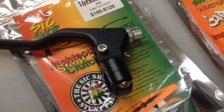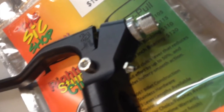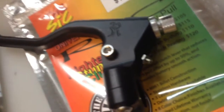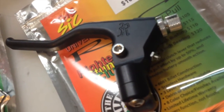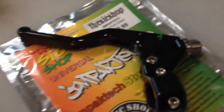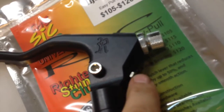Some people with shorter fingers may not want to pull as far. On the RSC there's also a set screw adjuster that you can dial in to push the lever out, setting where it rests when fully closed, to get the lever closer to the bar. I've really never seen anyone use that — the purpose would be for shorter travel — but most bikes won't work with it because you need the full travel to fully disengage the clutch. The Impact Tech does not have this feature.